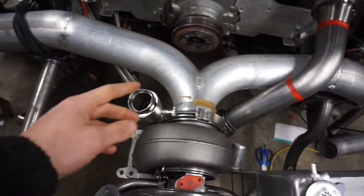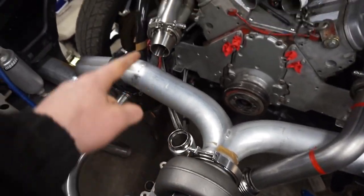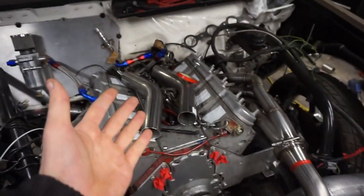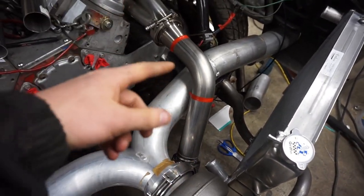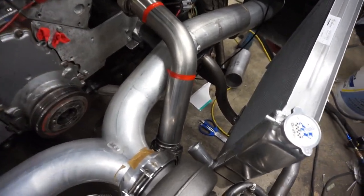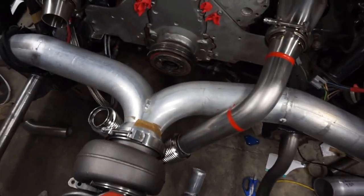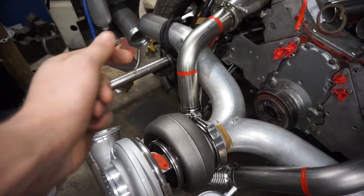I still need to cut this tube just a little bit shorter so the flex joints are in the same area. From that short time lapse there you can see me messing around with the 45 — I ended up going with the 90 and just cutting it shorter. Nothing ever works out as planned; you've got to be prepared for that. I just pretty much eyeball everything. I hold the tubes up to where I want them, mark them, cut them, give yourself a little extra room just in case you need to massage it a little bit. Still clearance everywhere, it's not too tight. I've got my flex tube down there so hopefully that'll save all my welds.